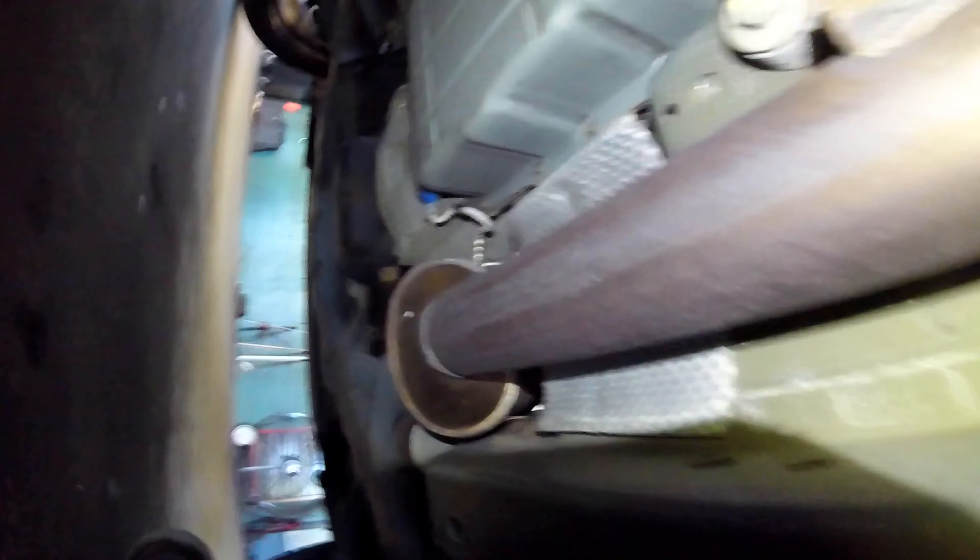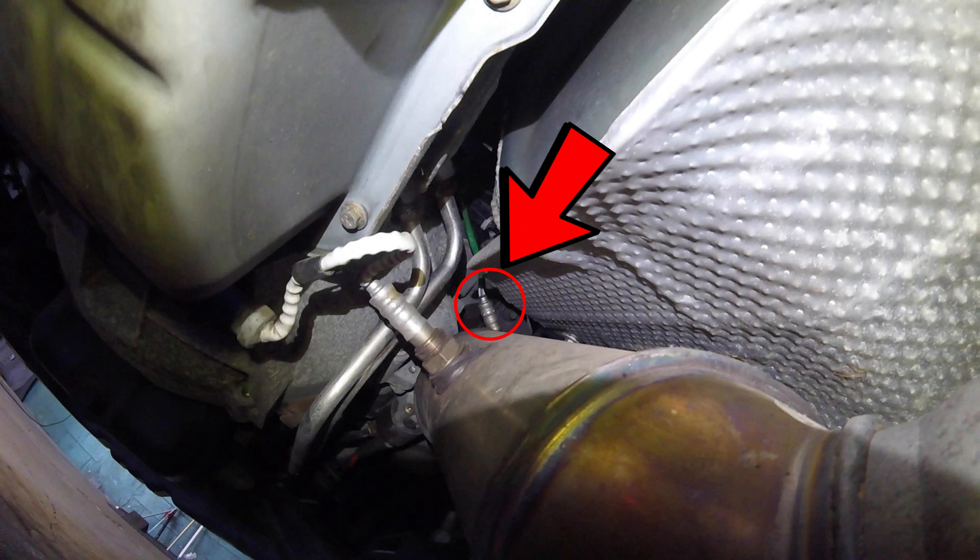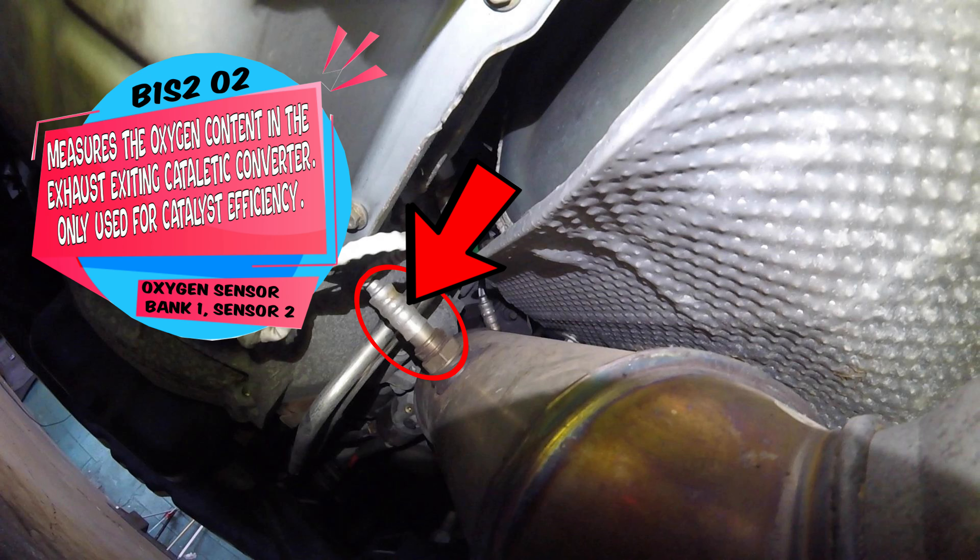You can see crawling under the car is a little bit of a struggle. You've got to make sure you have the vehicle jacked up to get to the oxygen sensors, and they don't look too easy to get to. The upstream oxygen sensors are actually air-fuel ratio sensors on this one. On the upstream, you have your bank one, sensor one oxygen or air-fuel ratio sensor. That sensor is responsible for telling the computer how much fuel is in the exhaust stream so it knows how much fuel to add to the combustion chamber to give you the best combustion. The rear oxygen sensor in the catalytic converter is only there to monitor the efficiency of the catalytic converter.